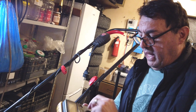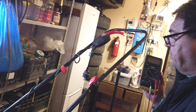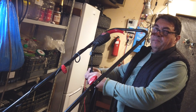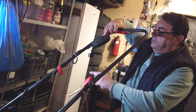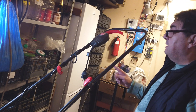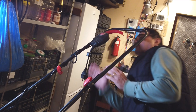Before anything else we have to look for shorts - we got the beep. I'm having the connector now, I push this and nothing happens, nothing at all. So we have two explanations: the switch is gone, or the motor is kaput. Hopefully not - maybe one of the wires. I really don't know.